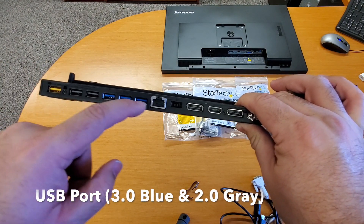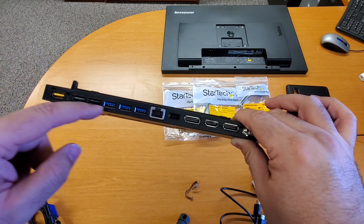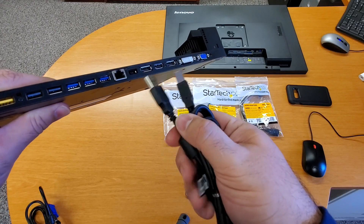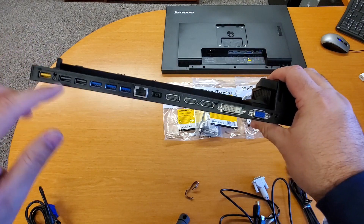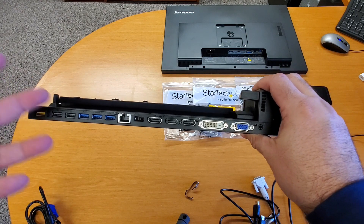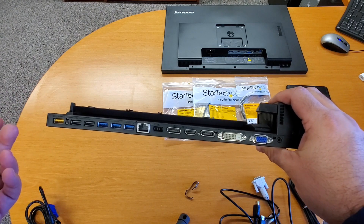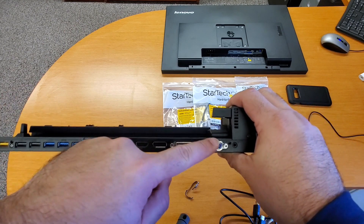These three blue ports are USB 3.0 — faster than USB 2.0. Note that sometimes printers will not work in the 3.0 ports, so if your printer was working before and now it isn't, try moving it to the gray USB 2.0 ports, which are somewhat slower but more compatible. Here's an example of a printer cable — plug one side into the dock and the other into your printer. The remaining USB ports are where you plug in your mouse and keyboard. Personally, I'd recommend going Bluetooth or wireless, but wired is always reliable. The last port most people use for charging their phone cable — so in total you have six USB ports available.